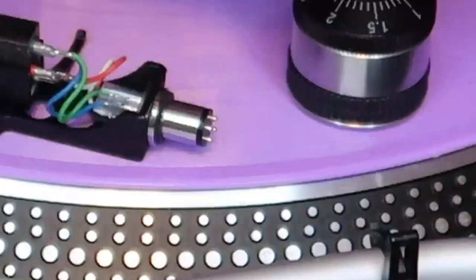Now, when balancing needles, some people like it heavier, some people like it lighter, but generally speaking you want to find the nice little sweet spot in between — one that isn't so heavy it wears out your needle quickly and sounds like garbage, or so light that if you sneeze the wrong way your needle flies off the record and ruins everybody's two-step. So without further ado, let me show you how to do this.